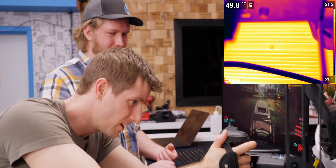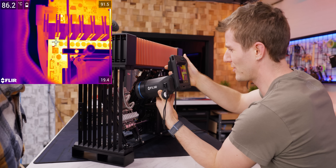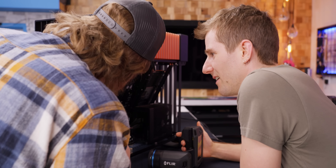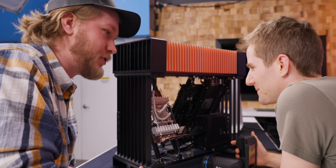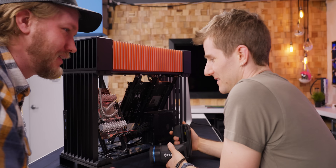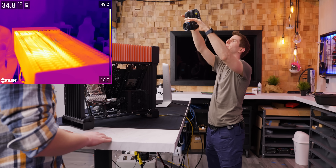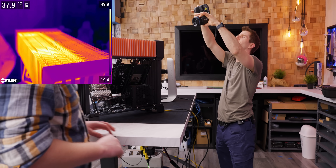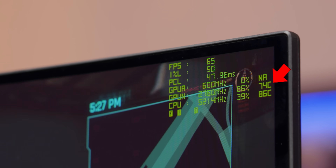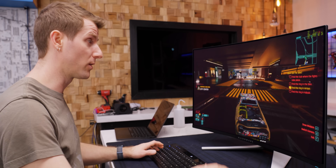How's our poor power supply doing? About 50 degrees on the outside — that's fine. How's the other side? I'm getting 90 degrees under this heat sink, and 93.3 on this chip right here — which has thermal compound on it. They did miss a couple of the GPU components; there's a couple here at 94 degrees. Nvidia probably doesn't measure those either. You can really see how much toastier the GPU side is. The CPU is running hotter because it's a tiny die and thermal transfer isn't as good, but the GPU is kicking out a lot more heat. Our GPU is now sitting at 73–74 degrees — that's normal for a system like this to take a little while to fully heat-soak.